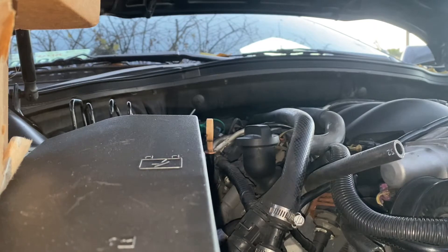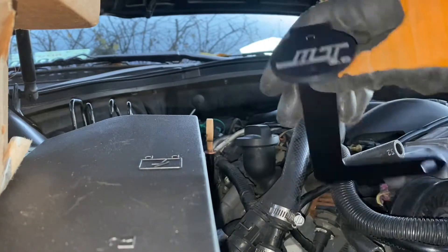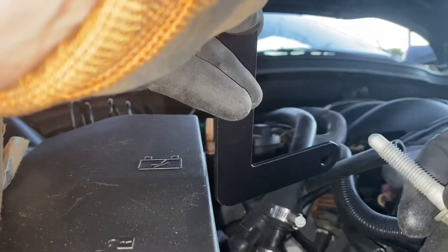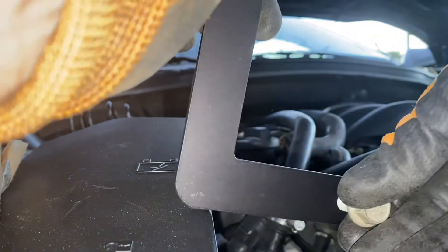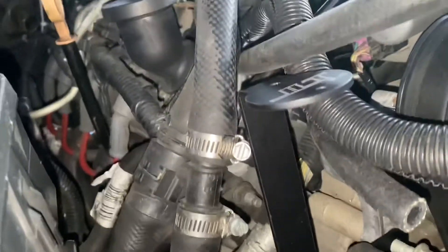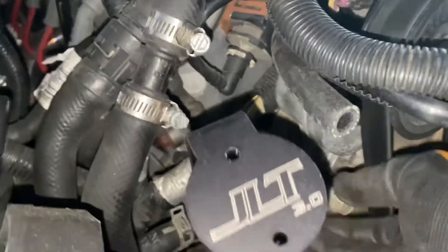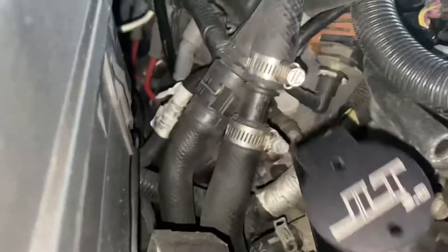Once again, you're going to get your bracket from JLT. It goes forward, and you're going to pull the bolt out from the bottom side of the belt tensioner. You put the bolt up inside there and put it right back. You can see it there. You're going to screw the bolt back in, hold the clamp straight like you're supposed to, then tighten up that bolt down there all the way.